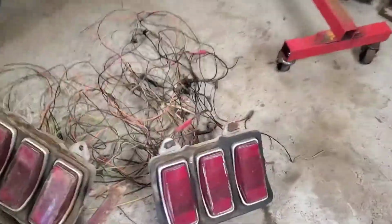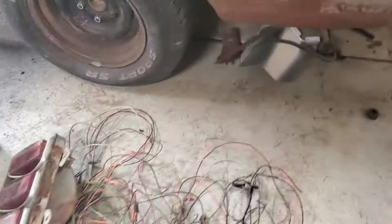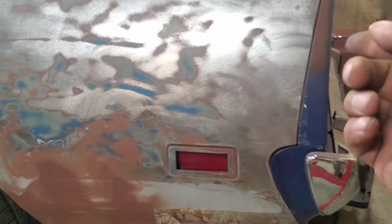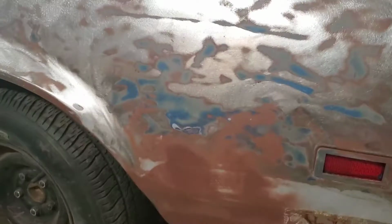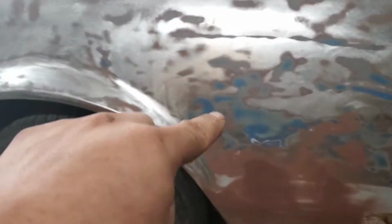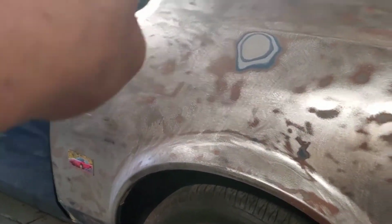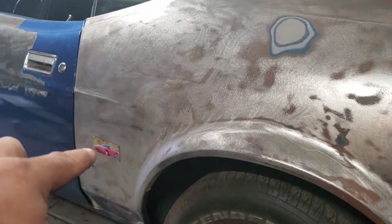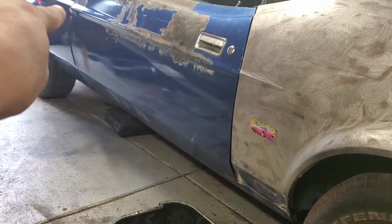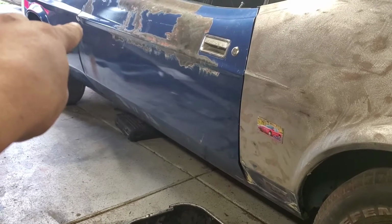Over here, we have our tail lamps, and then our harness. This one goes from your tail lights all the way along your quarter panel, and we'll use the 73 as a reference. So your tail lights that begin on your passenger side come all the way towards the driver's side, and then right all the way up. And then your courtesy lights would be around here, and then the wires continue down your rocker panel, and they would meet another harness that would be considered your underdash harness, and that's where you would connect them.